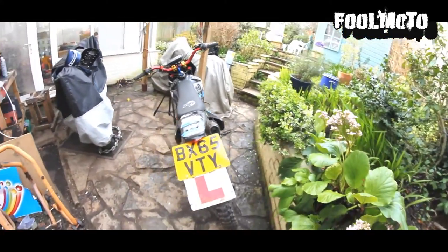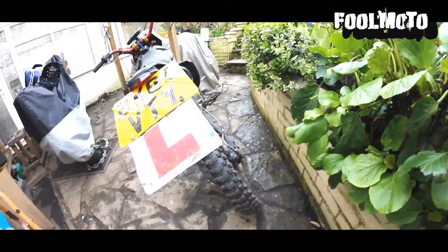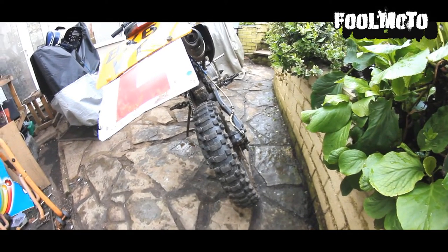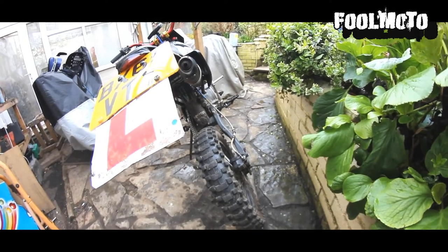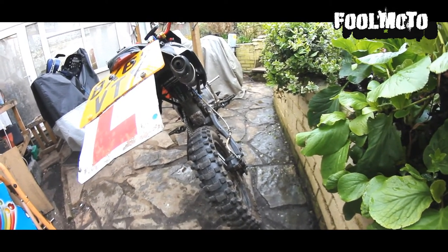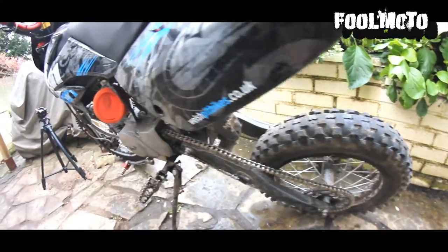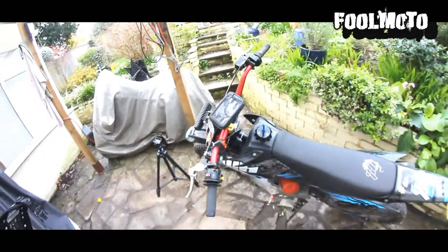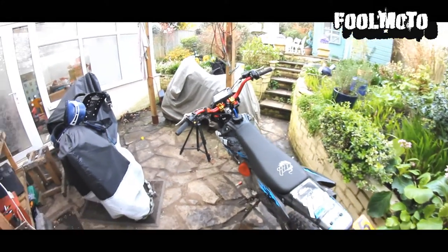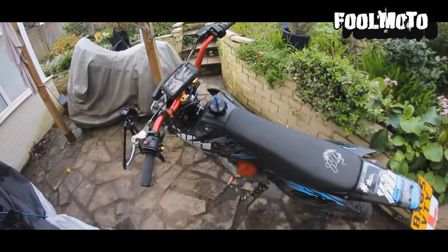That's the bike and everything I've done to it — everything else is completely standard. The only thing I've had to buy and replace since getting it is the rear brake caliper; everything else has stayed together really nicely. Keep maintaining the bike every week if you ride a lot — at least check everything after every ride to make sure it's all tight and keep everything greased up. This is the same chain I've had on for a year and a half — it just needs cleaning and re-waxing. The bike's held up really well and I recommend them to anyone. Please like, subscribe, and comment — see you soon!